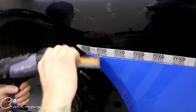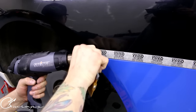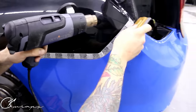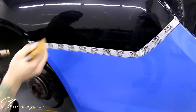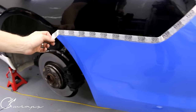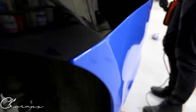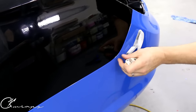Let's take this off — we've got to go over it one more time with heat to seal the deal. Use the thicker squeegee and heat it. When I go over the corners I round them like that — add a touch of heat — and that finishes it up really nice. When we look at the corner it generally looks really good.